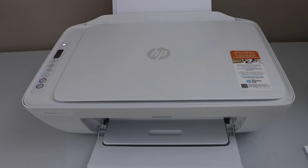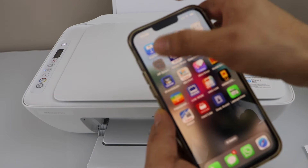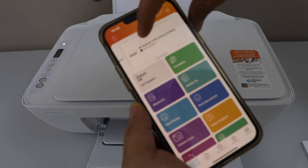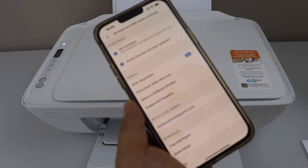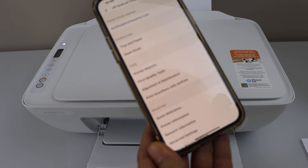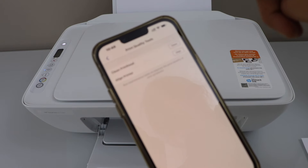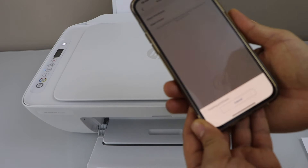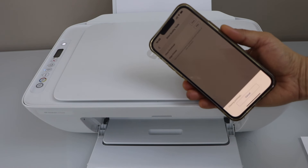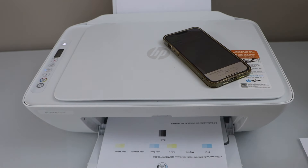The second step: go to your smartphone and open the HP Smart app. Make sure your printer is connected. On the main screen, click on the printer icon at the top, scroll down to the Tools section, and click on Print Quality Tools. Click on Clean Print Head and it will start the cleaning process and print a diagnostic page.